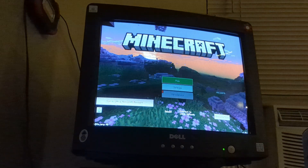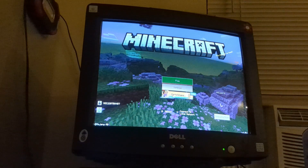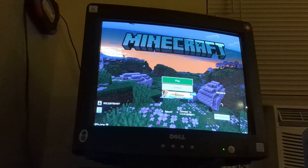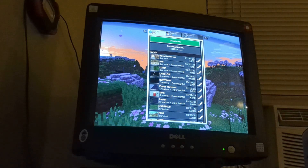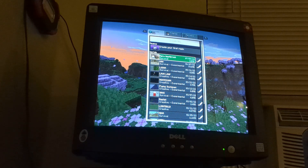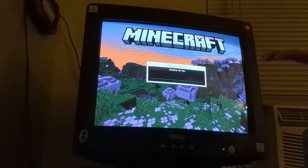If you do want full range, it's going to look a little dark, especially with a high-hour CRT like this one. If you're using a CRT TV instead of a monitor, it'll require a completely different kind of adapter. Going to full range or full RGB might look okay if you have the settings right, but the exception is my JVC series in my bedroom — that didn't look quite right. You might have better results with your CRT monitor at full range. This is a high-hour monitor, pretty dim — I found it's pretty dim relative to another monitor I have, which I'm pretty sure is lower hours.